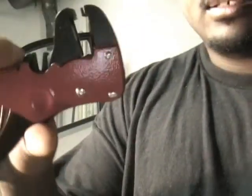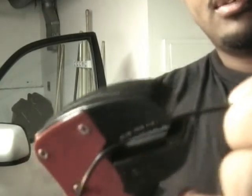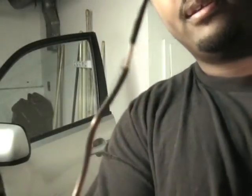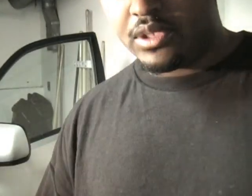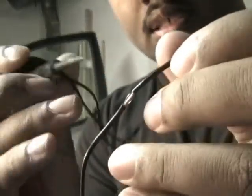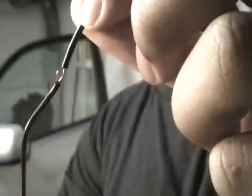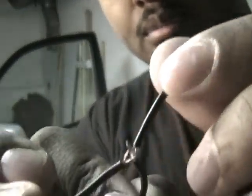When you're working with your car's factory wires, it's always best to never cut them. I'm going to show you how to do this. You take a wire stripper — these are really cheap, just a couple dollars — put it on the wire and pull the trigger. That strips some insulation away. Then you split the wire open and use something kind of sharp to go right through and separate the strands.